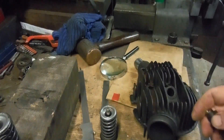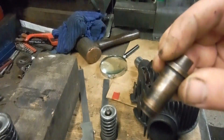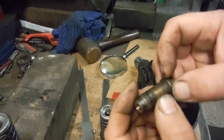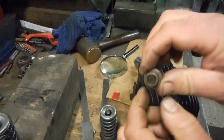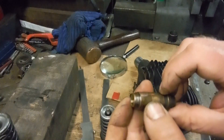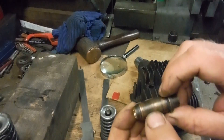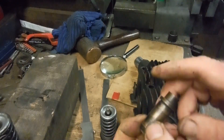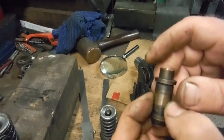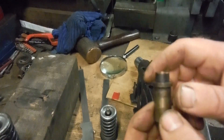I'll drill the hole and annular groove, then warm the cylinder head up again and fit this. There is a possibility that although I've machined it — holding it in the lathe by the flange section and boring through — the outer circumference could have become slightly deformed when it was pressed into the Royal Enfield cylinder head. So I'll go ahead and machine it, fit it, and see what alignment I've got with the valve and the seat. If it's okay, I'll leave it in situ.